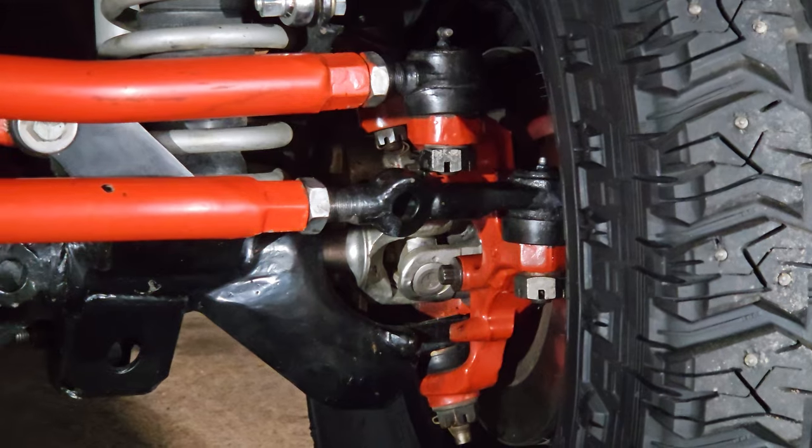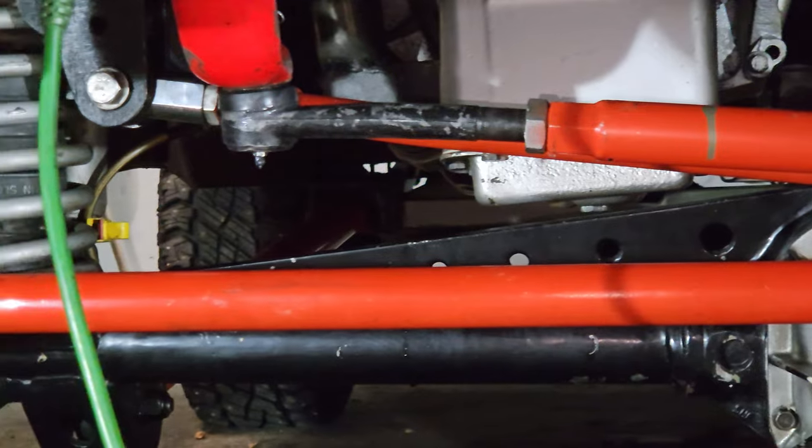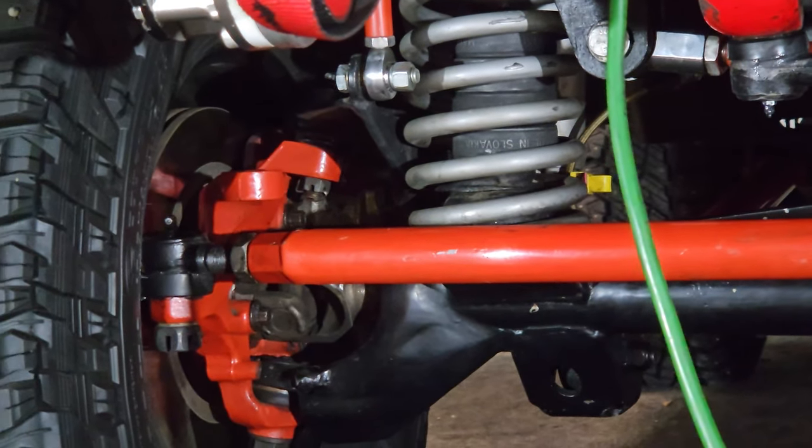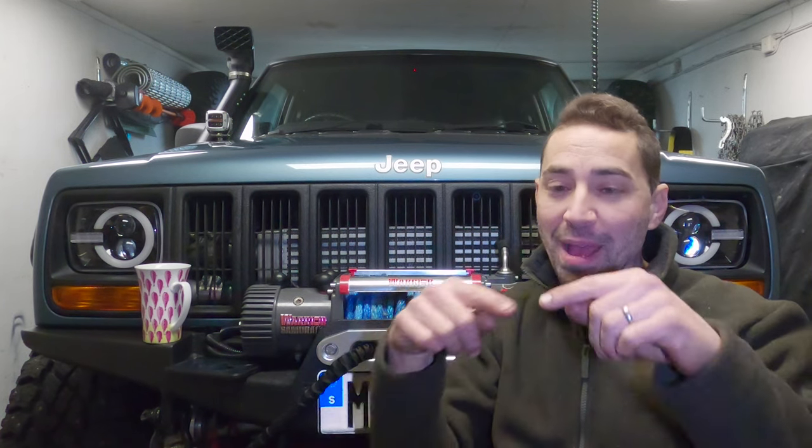On the front of steering - steering is usually something that gets neglected. I've seen some fairly built rigs out there running stock steering. If you're just doing it for looks, fine. But all it takes is nudging that tire into a curb or an embankment and it could bend that tie rod - I've done it on my previous setup. So if you're looking at suspension, you probably want to be factoring in some steering with it too.